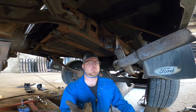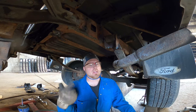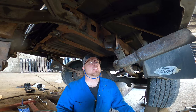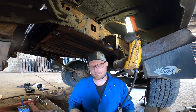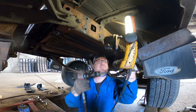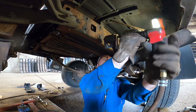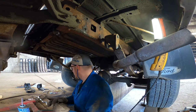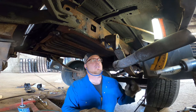That bolt was encased in a metal sleeve wrapped in rubber. The reason why rubber makes it so hard is because the amount of energy you put in there actually gets absorbed by the rubber. The heating cycles allow that rust to start moving — the molecules get energized and start cycling and moving around — and then because it's moving, it can break the rust free and come out. It works almost every single time. It brings your bolt difficulty from about a 10 down to like a 3. Once you get it moving, pop it down, give it a punch, and grab a longer bit if you need to.